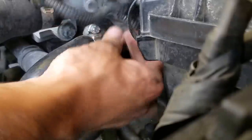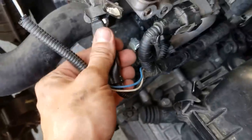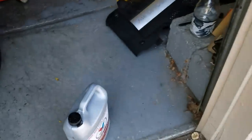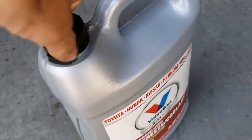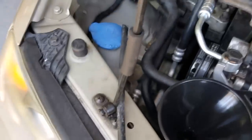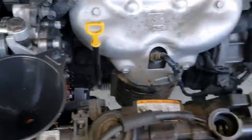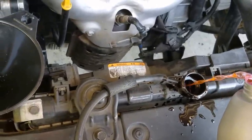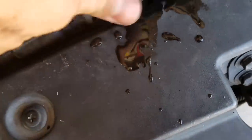Plug the sensor back in. Once you've got it all plugged in and snugged, you're going to want to go ahead and put back some radiator fluid — otherwise your car's going to overheat. I got this stuff for Asian cars. Put that cap back in — if you don't, all the coolant's just going to leak out the bottom. I'm going to go ahead and start filling up the reservoir. I think this should be good enough — I don't want to overdo it because this stuff does expand when it gets hot.